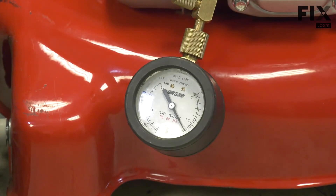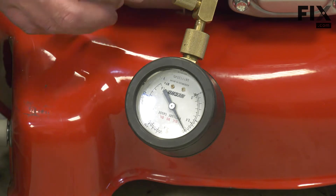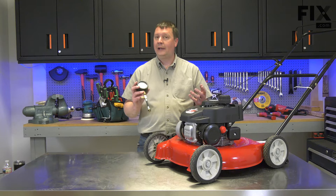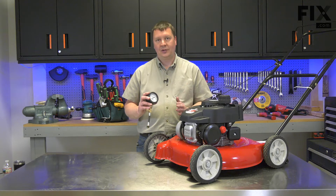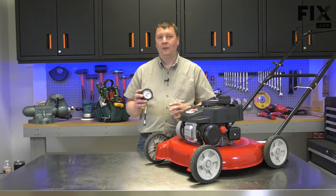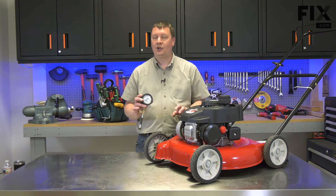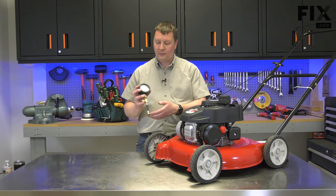The compression tester allows us to test the pressure in the cylinder, and there are a couple of tests we can do that will give us an idea whether it's the valves or the rings. The acceptable range for a compression test on a lawnmower or any larger four-cycle engine can vary greatly. Some engines have a decompression system built in, which makes it easier to pull the starter rope when you go to start the engine — those engines will have a lower reading. As a general rule, the compression reading can be anywhere from 50 pounds up to about 150 pounds. Sometimes the engine manufacturer will post a more specific spec and, if possible, use that as your guideline for your test.